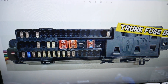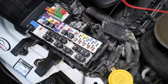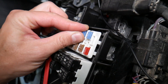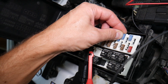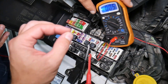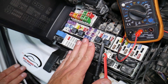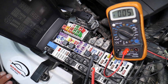Let's explain quickly why it's always a good idea to test fuses and relays. Fuses — not often can you see if they're burned or they're good. Sometimes they may seem perfectly fine, you think it's a good fuse, you put it back in and end up spending money and time on parts and problems that do not exist. When all you had to do was test your fuse, find out it's bad, replace it, and fix your problem. We'll have a video on how to test different kinds of fuses and how to test relays — we'll put the link in the description below.